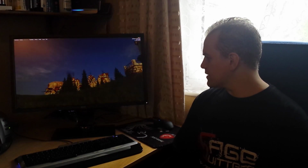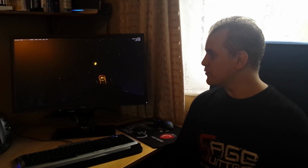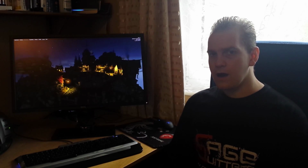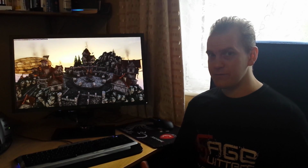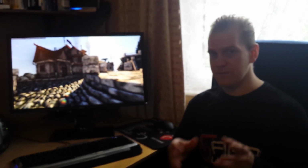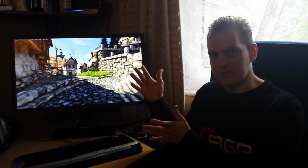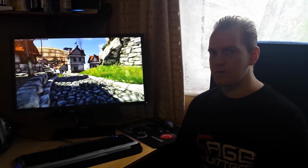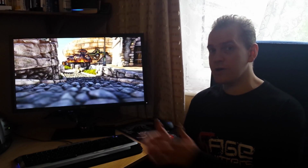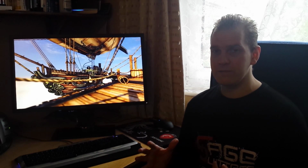What else can we say about the monitor? So as well as the great specs of the monitor being 144 Hz, the other thing is there's another AMD FreeSync monitor, and it's got a very good FreeSync range. If you remember from the previous review of the Asus screen, it had a limited 35 Hz to 90 Hz, so the top end particularly was capped, and it never felt that good to use. This one doesn't have any of those limitations. Slightly higher on the lower end, it goes from 40 Hz, but right up to the top of 144 Hz, and it is incredibly smooth to game with.